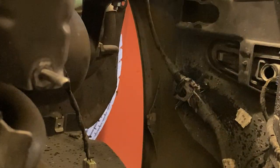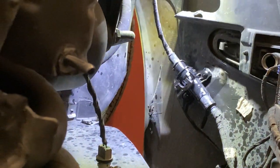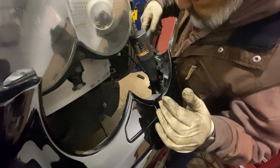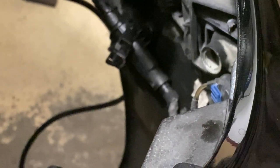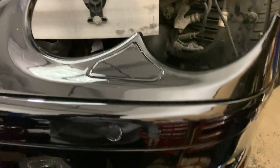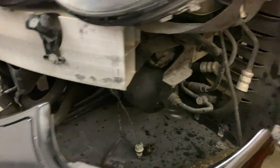The bottom of my bumper was completely destroyed at the time of recording — really deep scratches, brown spots, chips, and cracks. I tried to fix it as best I could. I taped off the portion with OEM paint, masked off the rest, sanded the damaged area with 800 grit and Scotch-Brite, and spray painted it with the same gloss black I used on the wire mesh. I also ended up putting a carbon lip on there, which I'll cover in the next video.